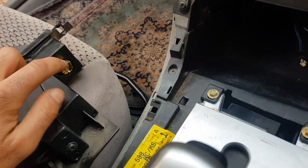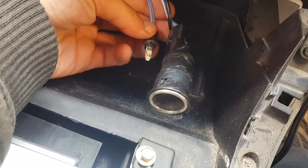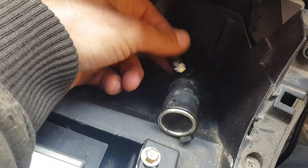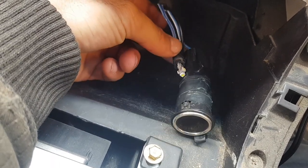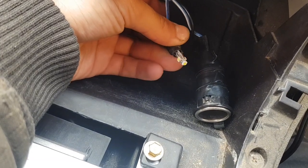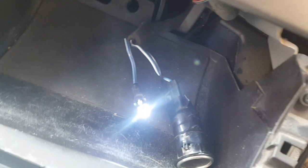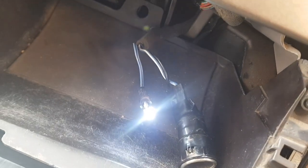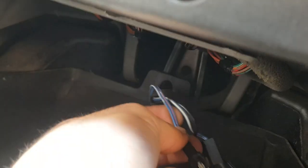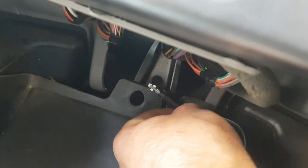Disconnect the wiring from the back of your cigarette lighter socket. You'll usually find this little bulb holder taped up to that wiring adapter plug. In this case, once you put a light bulb in there - it's a T5 size - I've got an LED in here, and every time that you turn your headlights on you're actually going to get some lighting from that bulb. So my plan today is to tuck this light bulb holder and get that wiring poking out through this bottom hole.